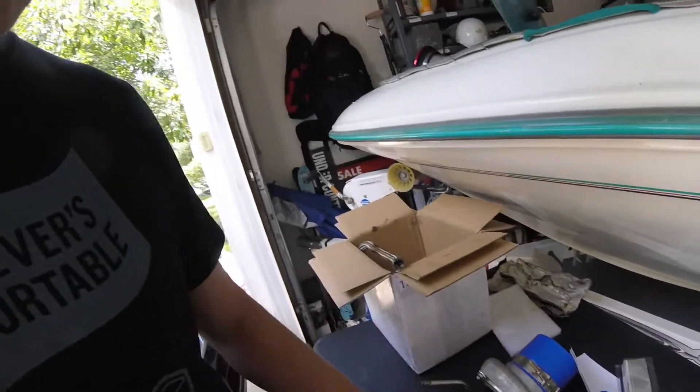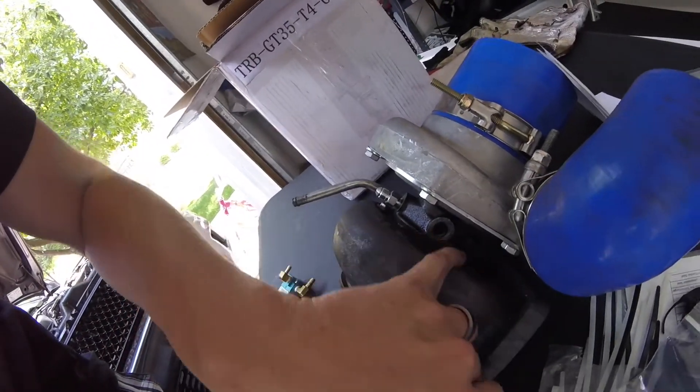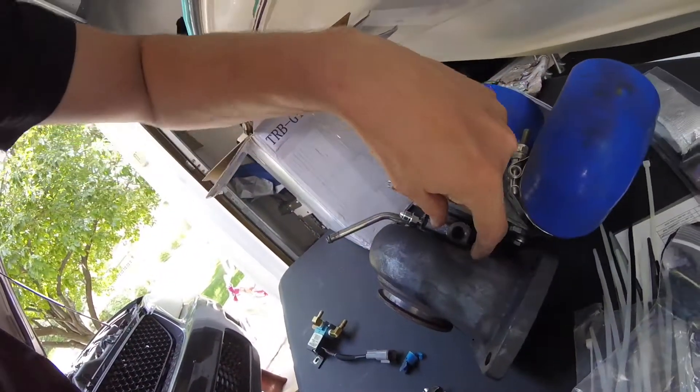I'm going to go ahead and put the new turbo on and keep the old one as a backup. I am going to reuse the exhaust housing because I did actually machine this exhaust housing down before I put it on the first time so I could properly tighten the coolant line. I had one of my subscribers comment that he has the same kit and had been having trouble tightening down the coolant line on the side of the turbo. I ran into the same problem, but I actually machined this side of the exhaust housing because it's plenty thick and I can now fit a socket wrench on there to tighten it. So there's the fix for you.